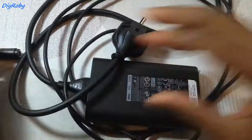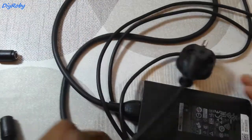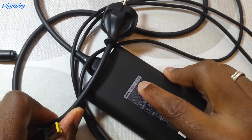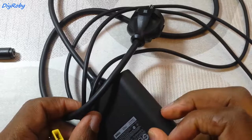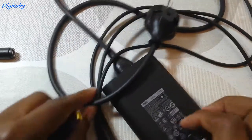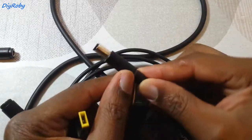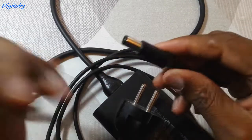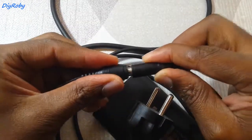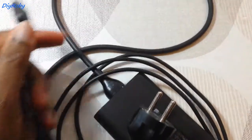You can see how well this works for the Lenovo, but surprise surprise — it works for a Dell laptop power supply too, because this is the same 19.5V, 3.3A, so 65W power supply. Dell now comes with a similar round plug with a center pin in the middle, and it fits perfectly. Not only does it fit, it charges my laptop too.